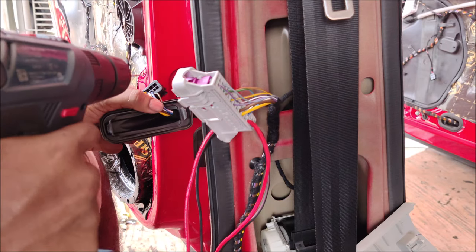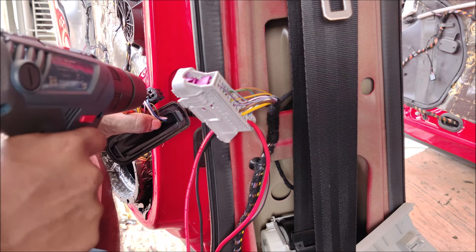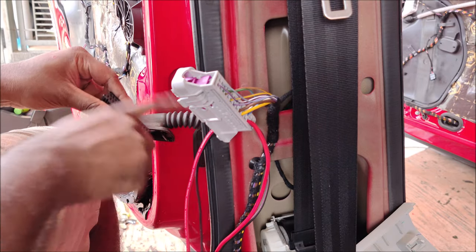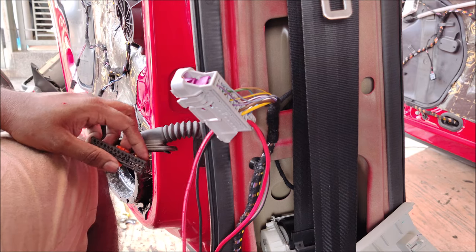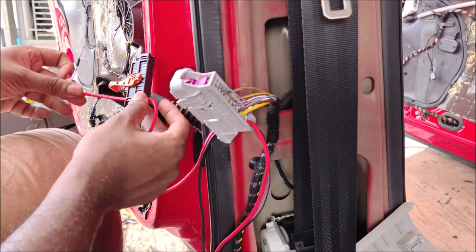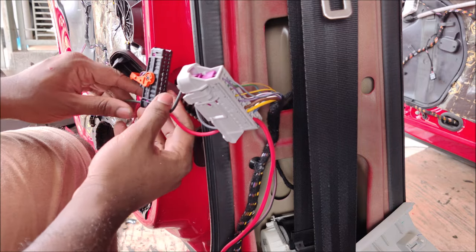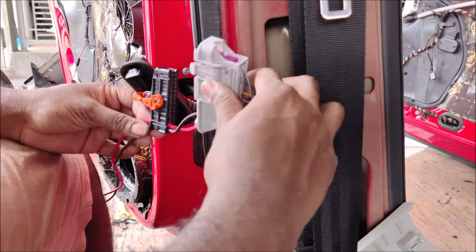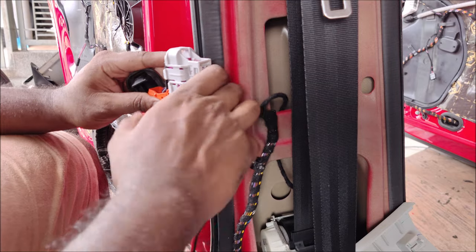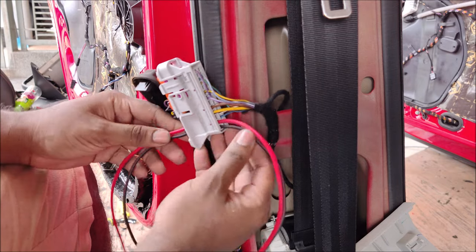I did the same thing on the male side and now I'm doing it on the female side — just slightly enlarging the hole enough to give clearance for the wire to go in easily. This applies to BMW, Mercedes, Volkswagen, and even the new and old Honda Accord — most of these cars have the same connection type. If you're planning to run new speaker wires, this is a good way to do it, but be very cautious — one small mistake and you'll screw up the entire harness.